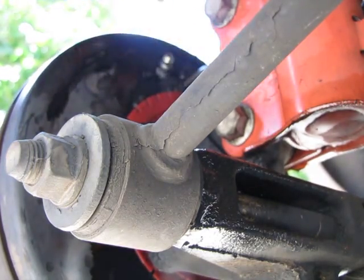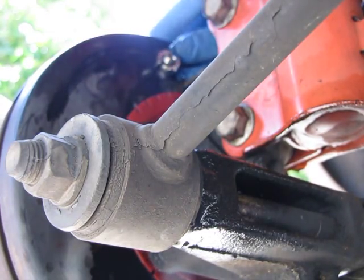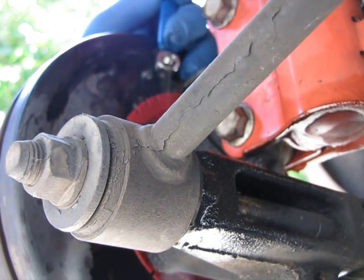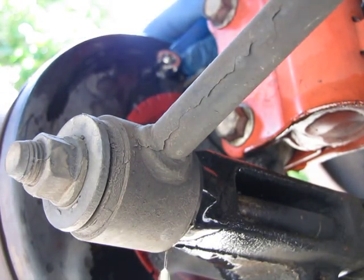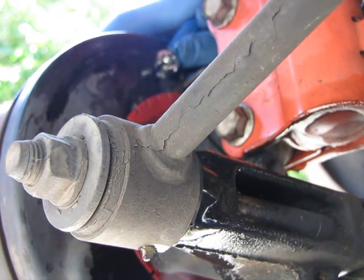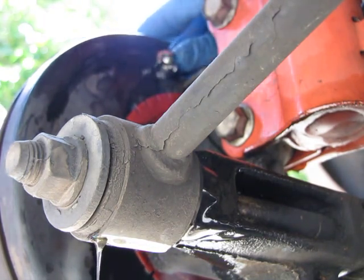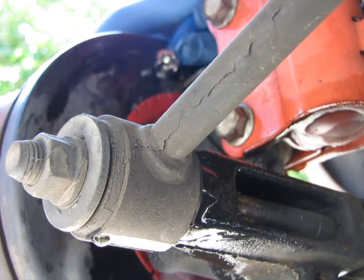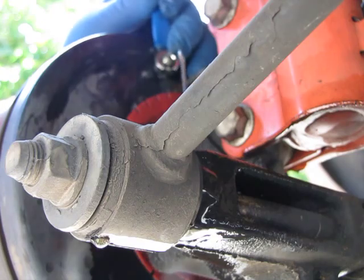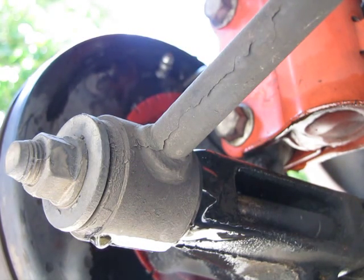So now we're on the left side over here. Put pressure on the pedal please — pushing down. Now we're going to open up. Slowly it should go to the floor. There it goes. Let the pedal up. Press back down, put pressure. I'm opening. Now pump the pedal a couple of times. Pump, pump. Now hold it, press hard. It's coming — should go down. Let it up. Press on the pedal — feel firm? Yeah. And that's how you bleed brakes. Thanks for watching.